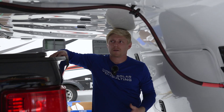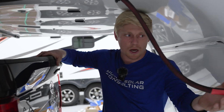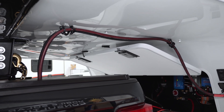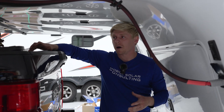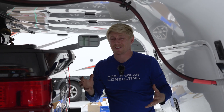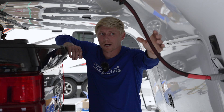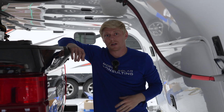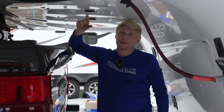What we found to be preferred for a lot of RV owners is a jumper cable. This space here is extremely tight — some models of RVs, it is not possible to fish a large cable through here. Maybe it's possible if you're fishing a six gauge wire through for an Orion XS, a 50 amp charger. But if you are fishing a 1-0 wire through for a 1700 watt Sterling charger, which is what we're using here, it's just probably not going to fit.